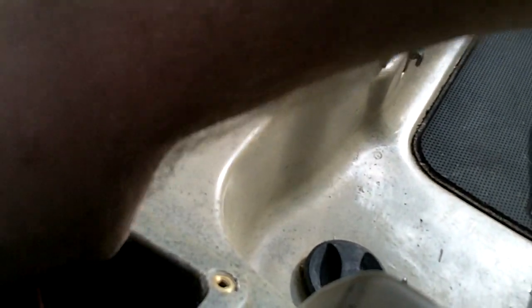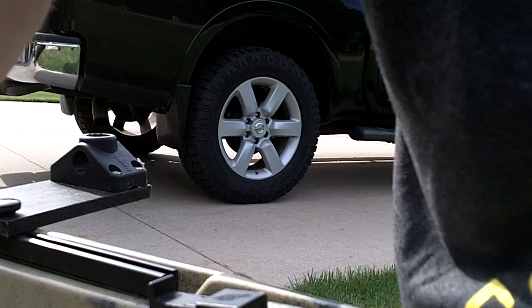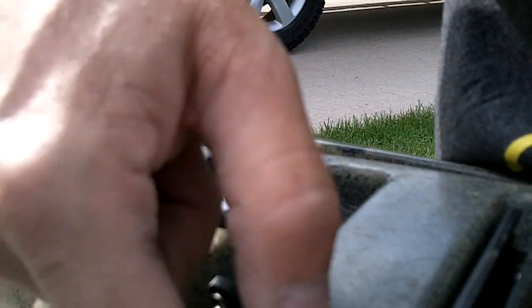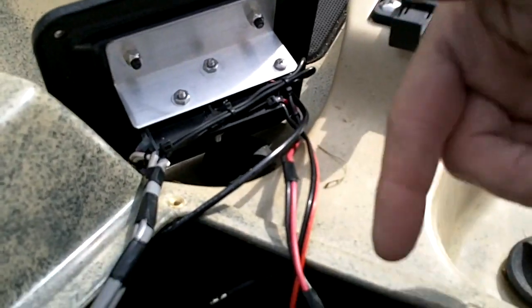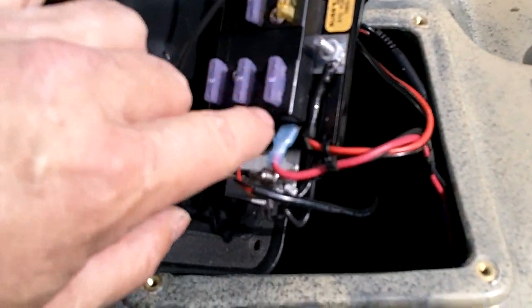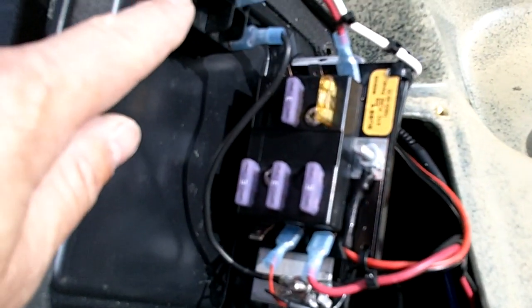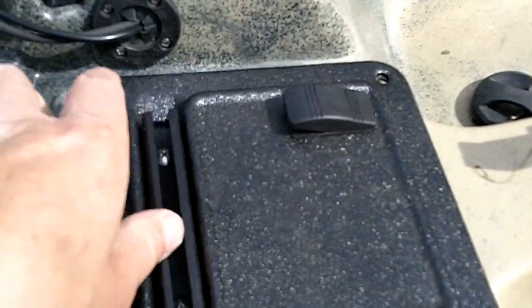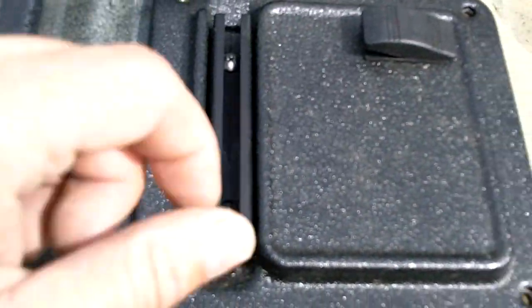Roy rigged it, so all I have to do is plug in. I have a pulse charger from Extreme — we're going to hook that to a male 12 volt, and eventually I'll be able to just plug the pulse charger in and charge it reversely from this cigarette lighter style plug-in. Here's the fuse block, purchased from Napa Auto Parts. It's just a 12 volt fuse block. And the switch right here we got from a boat store — a Lund dealership — just a nice panel rocker switch. So that's the electrical system, inside and out.